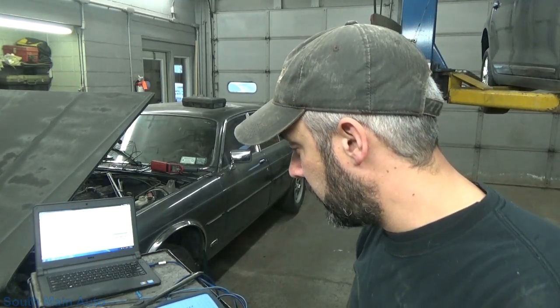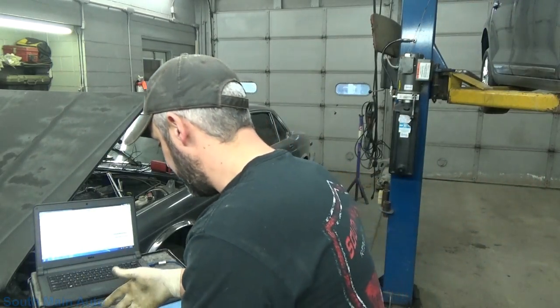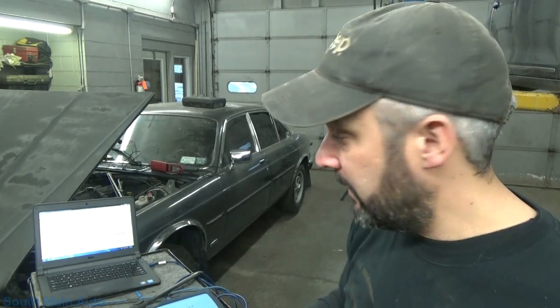So that's the digital wheel speed sensor on this Buick LaCrosse. Like I said, we didn't 100% need the scope for this one because of visual inspection. However, it is good to gather these waveforms when you have the opportunity. If you could not see that tone ring, at that point you have to make a decision: is it the sensor or is it the tone ring? And if you don't know what the amplitude of the signal is supposed to be — because it's not in any of their literature — the only thing the factory service info states is that it is supplied with 11 volts and that it produces a digital square wave.